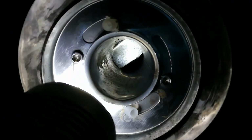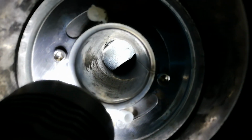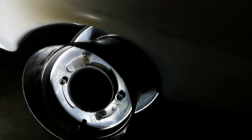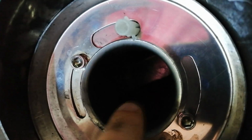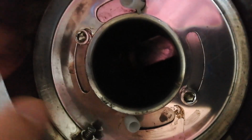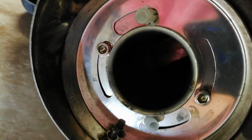But what I've also done while blocking up my exhaust with those 3-inch flanges is, if you look in here, I've added some of that galvanized steel to block about 3/4 of the exhaust coming out the back there, and also to shut it up because this slide didn't close completely. I just chucked in some plastic screw fittings just to block those two little holes on each side, which made a little bit of a difference, but I thought every bit counts. So I've done that, and I passed this procedure, I guess you could say.